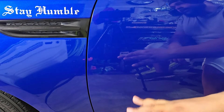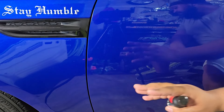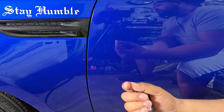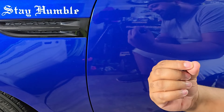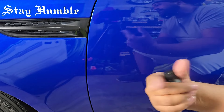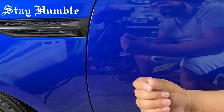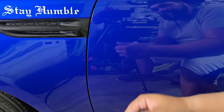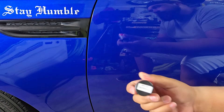I've got to do this to the whole car. After I'm done with that I'll show you the coating going on. Alright, so I got the whole car polished with the C6 APP and wiped it all off. There are a few spots — if you use a pad washer with that drooling pad and it has any moisture, it's very hard to wipe the polish off. You may want to get a few pads. When I went over the vinyl, it would pick up dirt and contamination and turn it black, so I had to wash it a few times and dry it really well.